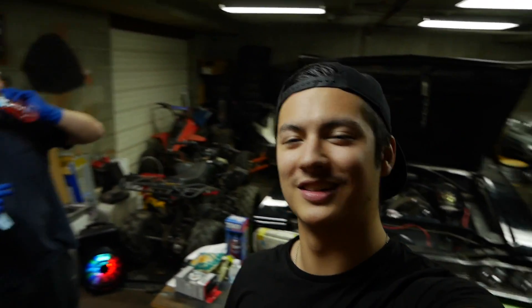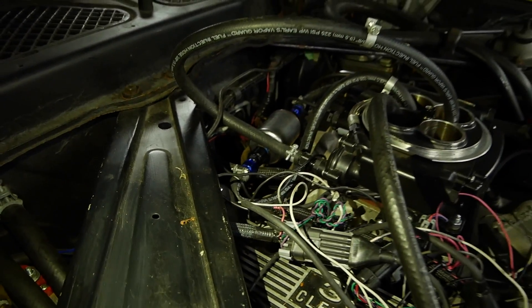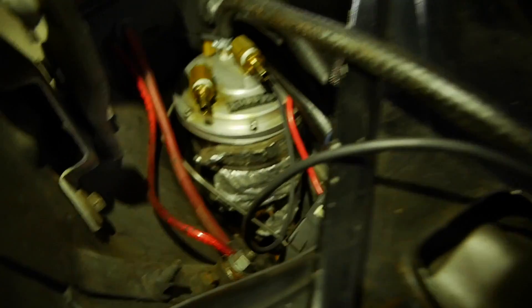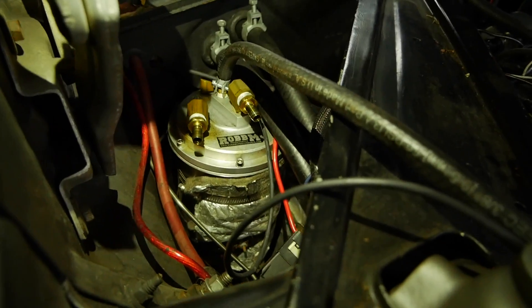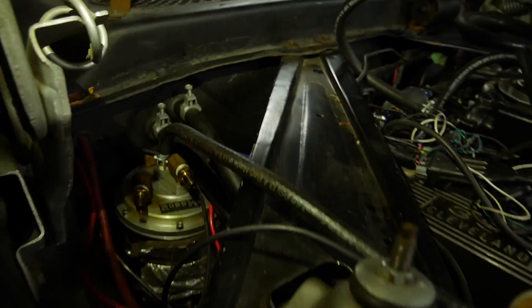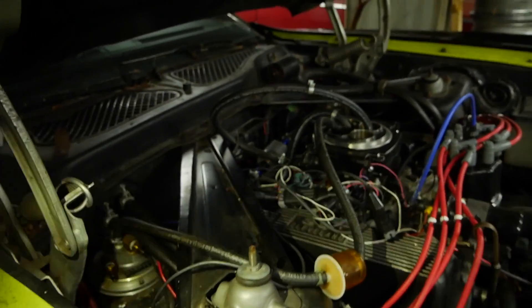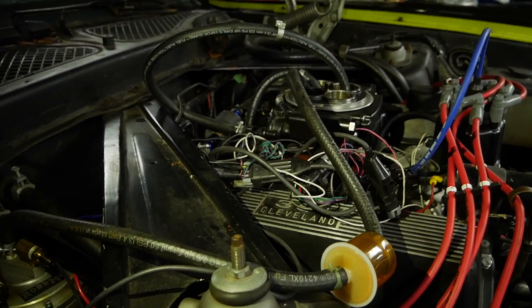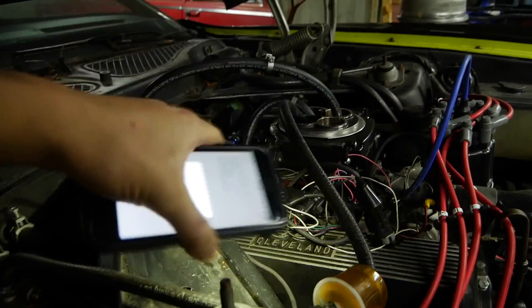That thing's going to go inline right from the back, so we're cutting up the AEM line now. It's going to be all hard line - it's going to be real nice. As you can see, that's my surge tank in there. We took the first couple lines off to drain the fuel but it's a whole mess right now - bunch of rubber line. We got two filters that were sitting behind the throttle body. There's a 10 micron that I need to use for the sniper. There's the surge tank that was sitting in here with the pump to bring it up to EFI standards, and feeding that thing was a mechanical pump. So we're taking all that out, putting one simple inline pump in the back, and it's going to be a whole lot cleaner.